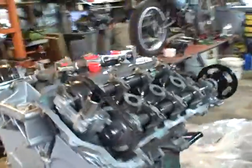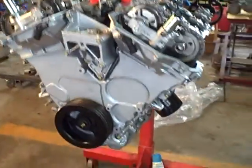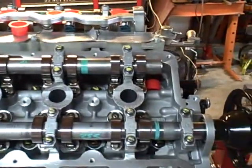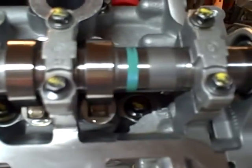I put six quarts of oil in it and filled the oil filter. I've turned it for about five to ten minutes with a breaker bar and I can't seem to get any oil up to the camshaft. There's a little oil in there — this is where I poured the oil in — but up here I don't see any oil coming out of the lifters.